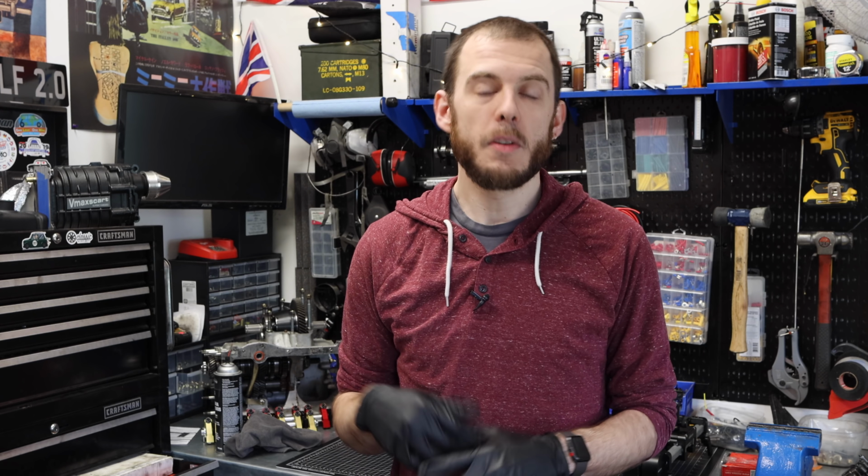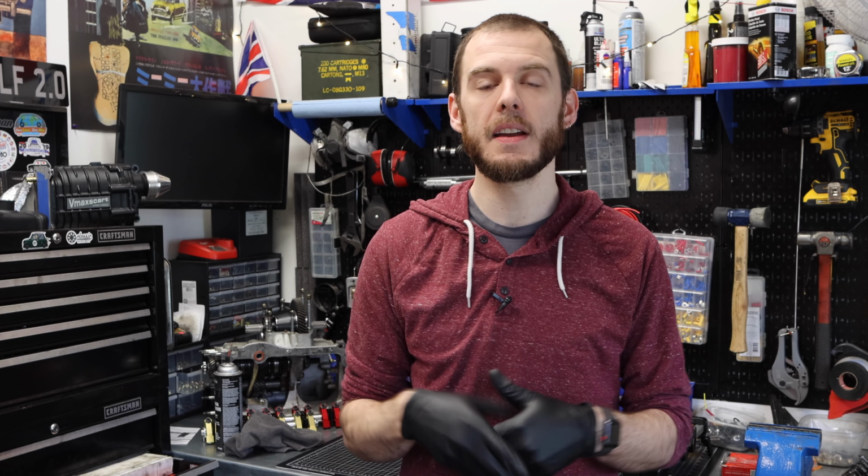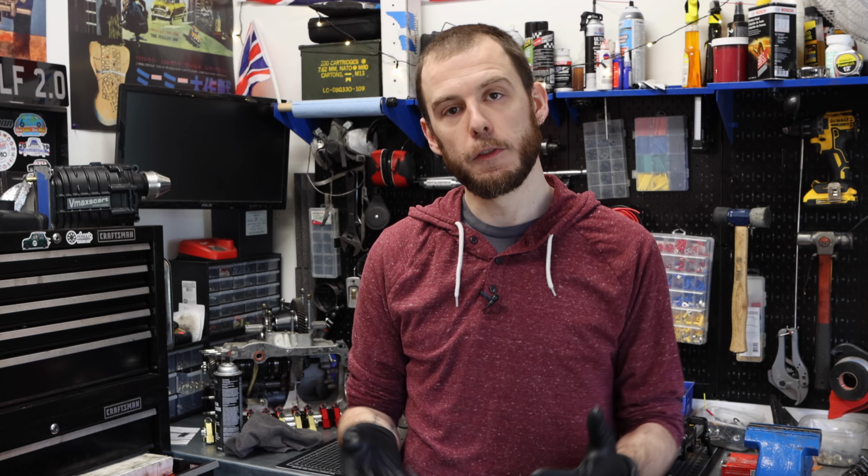I tried to get a video for you guys, but I just couldn't get the detail to show you the damage. And when I was taking them off, they were a little bit wet, but I couldn't remember if it was when I was taking the lines off, if the brake fluid just dripped on the brake lines and the brake systems and everything. Unfortunately, what that means is I can't use those calipers.